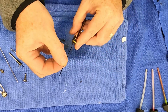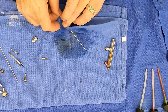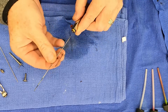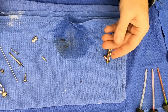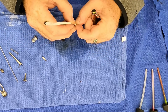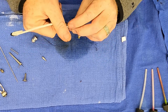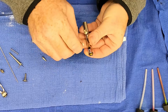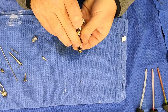Sometimes I'll take the needle and put it through backwards to see if any little chunks come out. There's still paint down in the hole in the back — pull that through and wipe it off. Keep doing that until you don't get any paint on it. See how much less there is on that go around. Sometimes before you start cleaning, you might want to spray water through it, or whatever solvent you're using. When you're using car paints, you'll use thinner or reducer to do the same thing that the Windex does here.